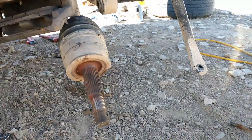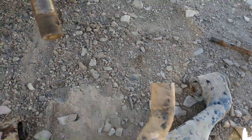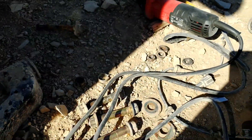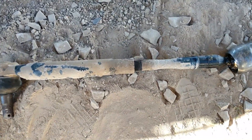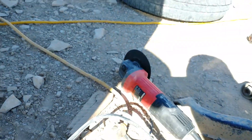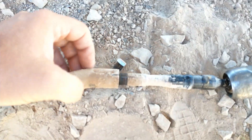That was the only thing I didn't anticipate — not being able to get those bolts out. It also makes me wonder if the tire shop ever did the alignment properly. When we first got this vehicle in Minnesota it kept feeling weird, and they said it was fine. I ended up cutting the nuts in half with a grinder and a cutoff wheel, then knocking them off with a crescent wrench. I didn't need to worry about the threads since these are going in the garbage anyway.